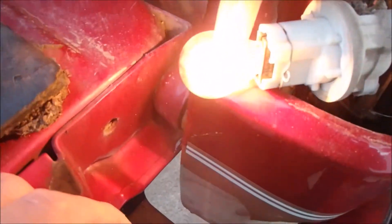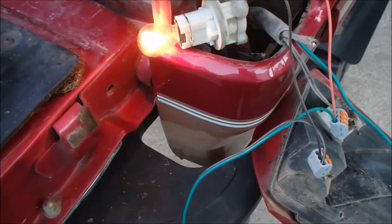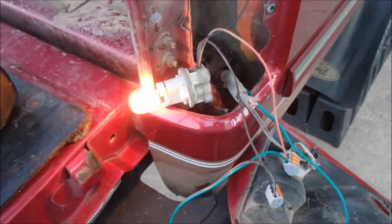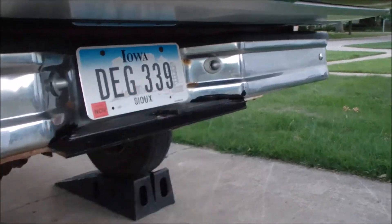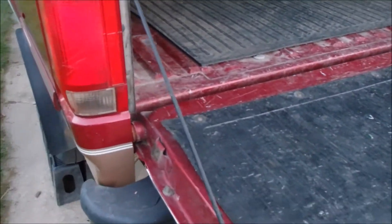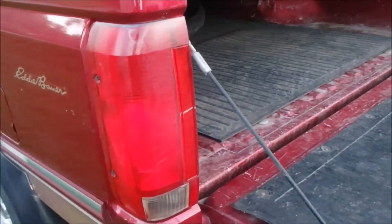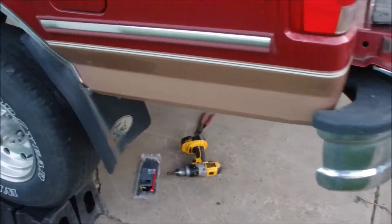I just didn't want to mess around with trying to connect to the factory wiring underneath, so I just did this. I'll go ahead and just slap it all back together. I know both sides work - tail and turn work. Just tap the brakes, make sure that works and we're good to go. Just slap the tail lights back in. One more quick note: the license plate lights, I just spliced into the running light. It doesn't matter which side. I just spliced that in and grounded it to the chassis. So all the lights work, they're back in. That's pretty much project accomplished.